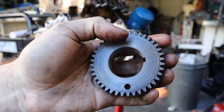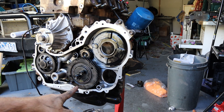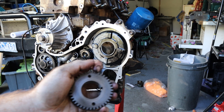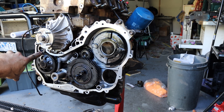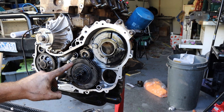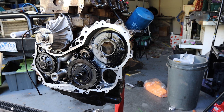You can see that 1-1 near my thumb and that 5 near my pinky. Now, that corresponds to a 1 and a 5-5 on this gear. So you want the number 1 between these two number 1s on the oil pump gear, and then that number 5 between the two 5s on this idler pulley. So 2-2 and a 2 here and they're lined up correctly. That's where we start, and then we slip this gear on so that it lines up with this, and then we can spin that at the same time, make sure they line up, and then do the gear on the fuel pump to match this and that gear. I'll show you a close-up once it's all correct.